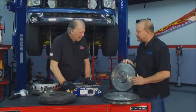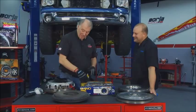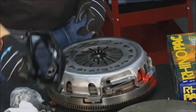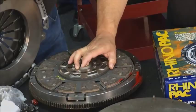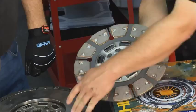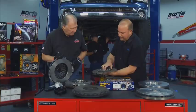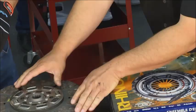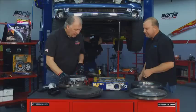For the guys out there who really want to jack up the horsepower on these things — and they do — we've got an extra high-performance unit here. This is a dual-disc conversion kit designed to replace the dual-mass flywheels. The discs have ceramic buttons on the center plate sides and organic buttons on the pressure plate and flywheel sides. That allows for much smoother engagement, so guys who have turned up the turbos or are hauling heavy loads get a much smoother engagement.